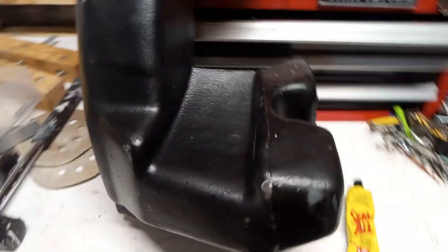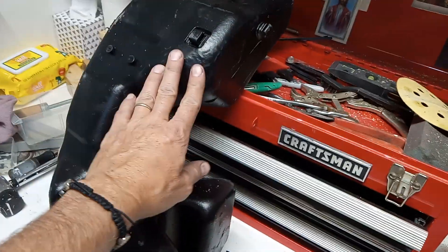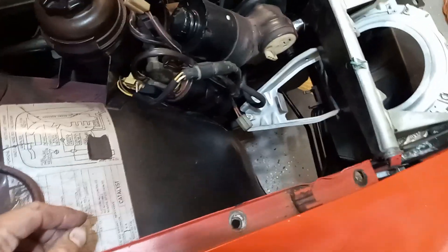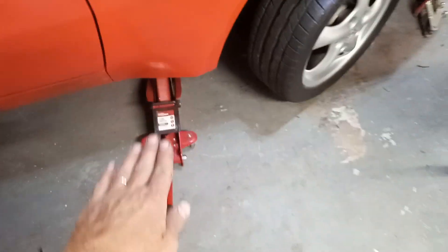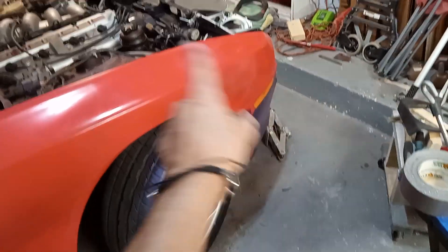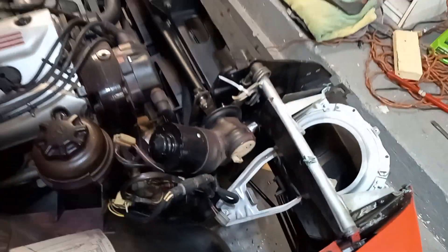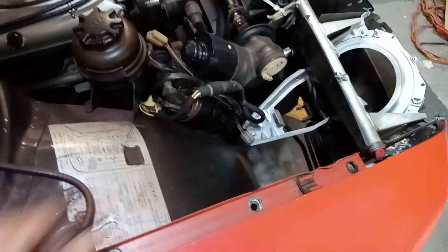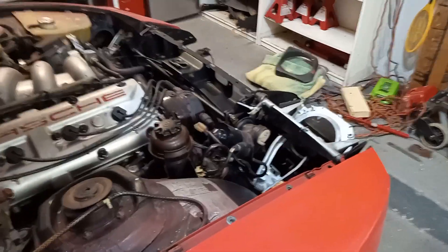Anyway, Tim Shark House Bros., thought I'd share that tip with you. I used Flex Seal, Seal All, and two tubes of JB Weld to repair the 944 water reservoir. I have a feeling this is very common — I've had it on other cars too. You will need to jack it up because you have to raise it to drop it down. It does come out from the bottom going in — you cannot fit it from the top going down. You can slide it in place from the bottom up. Okay, that's it for now. Thanks for watching.